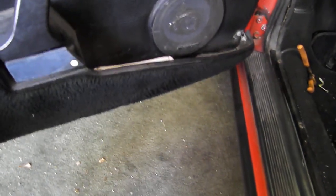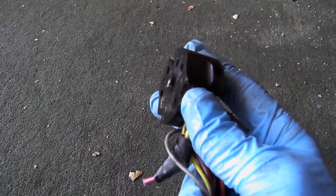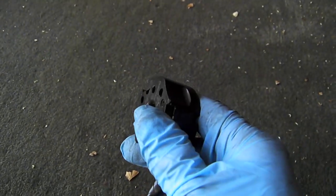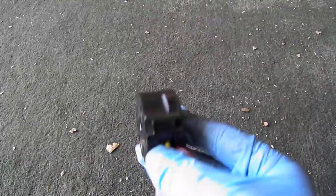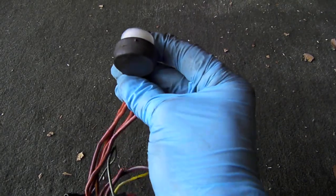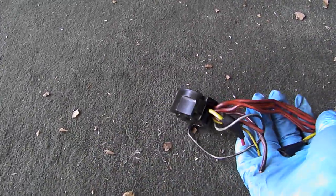I've done this project about 10 years ago when my dad showed me how to work on auto electric, so I do have an old Porsche 911 ignition switch — originally from the last one that was on here. This is the back end of it. The back of the switch actually comes off: just get a small screwdriver under the little tabs. Be very careful because the wires are loose inside and the cap is the only thing holding everything together. Make sure to disconnect your battery before working on this.